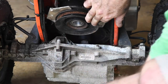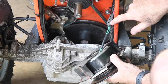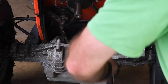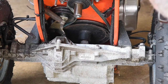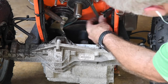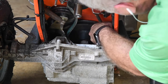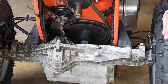Pull it out — that's what the bolt looks like. The clutch will drop. There's a power connector for the clutch with a little tip that you have to get the guard up off of — sometimes by hand, sometimes with a screwdriver. Pull the clutch off. Here's the drive belt we just played around with — I've got my drive belt super loose, so loose that I can just with my hand pull it off the transmission pulley. That's how loose this one-inch longer belt is.